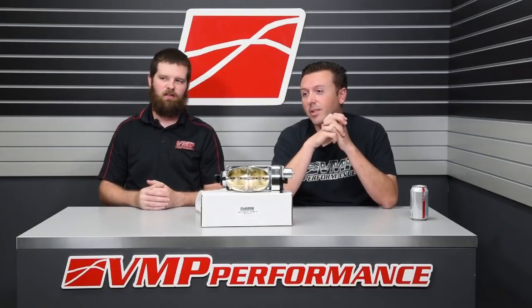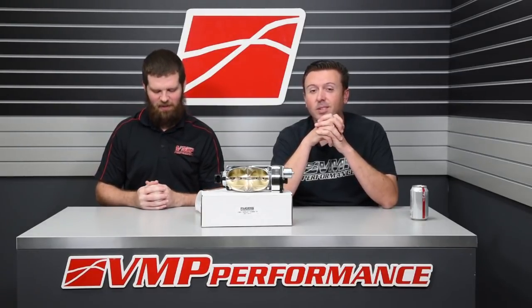Sounds good. First one is Hassan, he's thinking of putting a turbo on his 15 Fusion Energi. Would you be interested in tuning it? I could probably do EcoBoost stuff, but I don't know what the Energi is. Is that like a hybrid? Is he talking about putting a turbo on a hybrid Fusion? Got to see if a tuning company supports that. Yeah, not only that, but hybrids of the world, like Priuses, run the electric motor at wide open throttle and just supplement the power and the current request with the engine. So I don't know that a turbo would really net anything if that's truly a hybrid car. When you have an electric motor working for you, things get interesting. I wouldn't do that, buddy. I'd do a Tesla rear-mounted motor swap. You've got front and rear wheel drive, independently controlled.